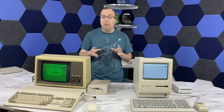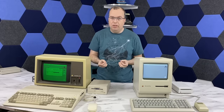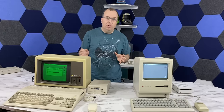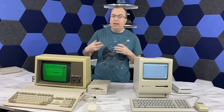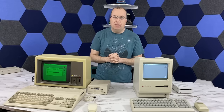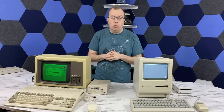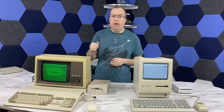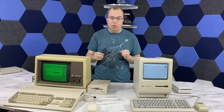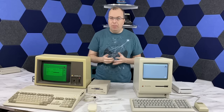AMAX also supports the use of hard drives, so you could create a custom Apple partition and do considerably more complex tasks. I don't have that equipment to show you, but I've seen that in operation, especially on Amiga 2000s and later models. Speaking of the 2000, there was also an internal card you could get that had the AMAX ROMs on it, the floppy drive port, and an AppleTalk network connection, so you could actually network with other Macintosh computers. That would have been pretty cool.